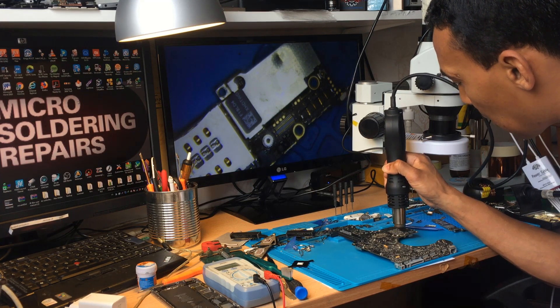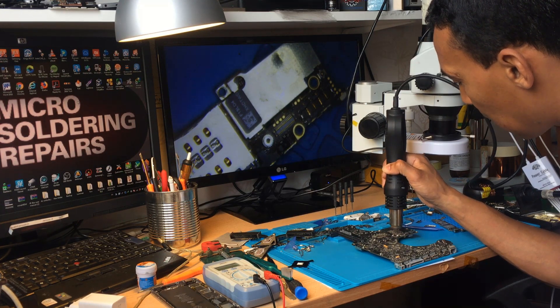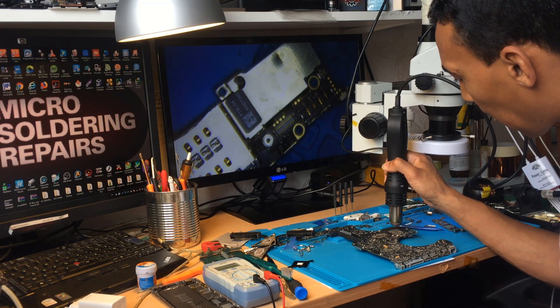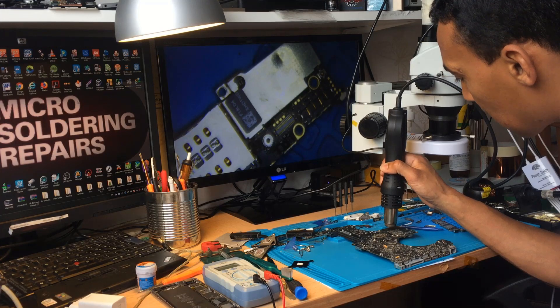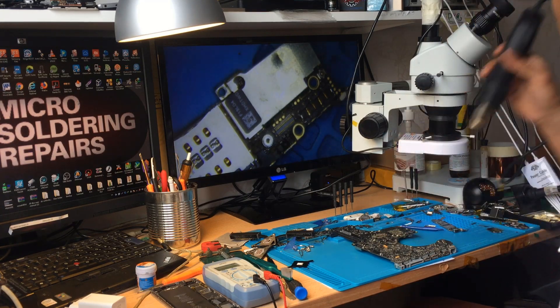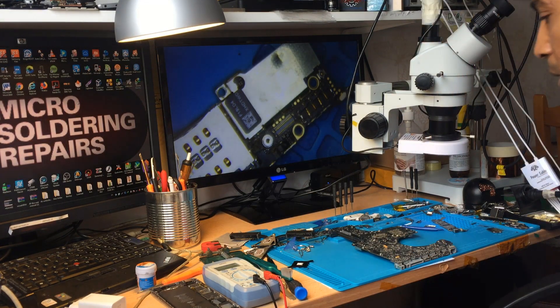Some people prefer to put the whole motherboard in an oven for a few minutes. Sometimes it doesn't work — it used to work with the MacBook Air, but when the lifetime of the graphics card is over, you can't do much about it. Then you have to go through micro soldering and rebuild the graphics card. Now let it cool for another five to ten minutes, then assemble your board, put it back, and try your computer.